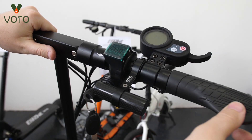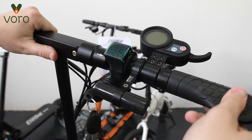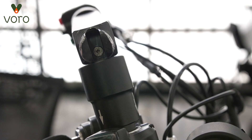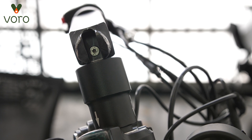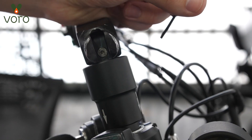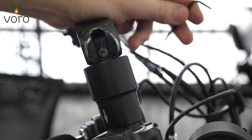At the top of the scooter we're going to start talking about handlebars first off. You're going to notice a little bit of play in the handlebars themselves, which can get really obnoxious when you're going on bumps. So in order to fix this we're going to grab this center here, push it, and fold it down. You're going to see a tiny screw on the inside — you're going to need an allen wrench at size 2.5 to fit in there. This is going to feel a little backwards: you're actually not going to want to tighten that screw. You're going to want to loosen it, because the goal is that this nut is filling the space on top. If you tighten it you're going to end up making more space in the socket which is going to give it more play. So give it a little loosen to fill up the gap.